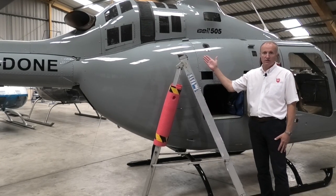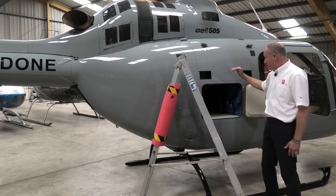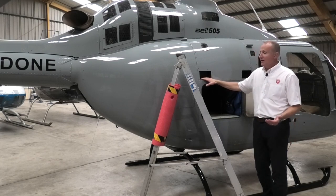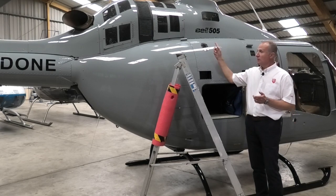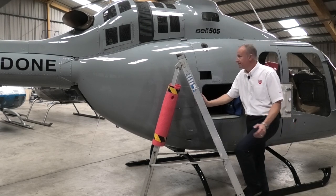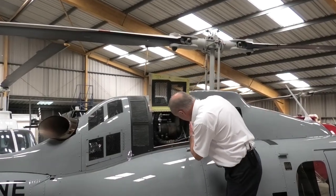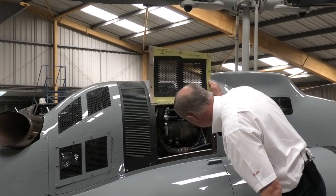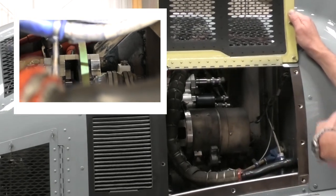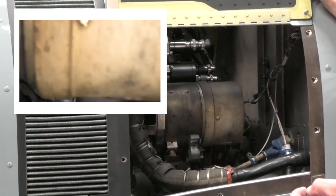Next item we check is the forward section of the engine and the accessory gearbox. You would normally do this coming down from looking at the main rotor head, staying on the boot floor or in the footsteps. We're going to open this panel so you can see exactly what we're looking at. The first item to check is the forward bulkhead — just checking for condition, looks great. Moving downwards, we check the rear end of the K-flex drive shaft exactly as we did in the transmission area — looking at the plates, the nuts and bolts, the integrity, and the witness marks.